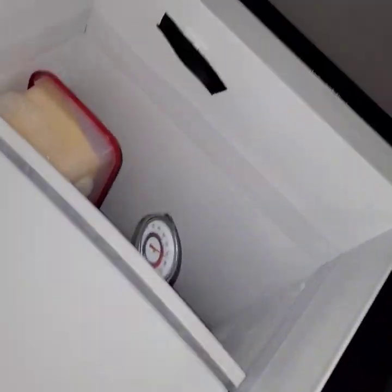Now I'm going to show you the rear. Tape your door and make sure you turn off the lights in the customer's home so you can see the defrost heater turn orange. There you go — you can see it now, it's all heating up.